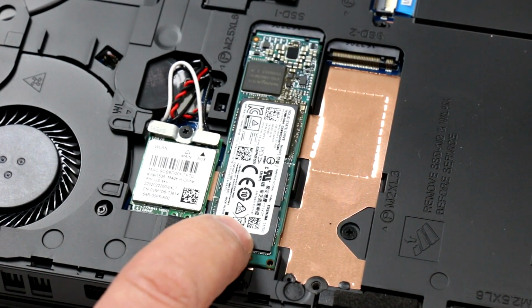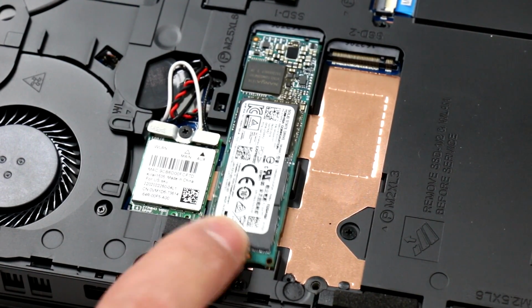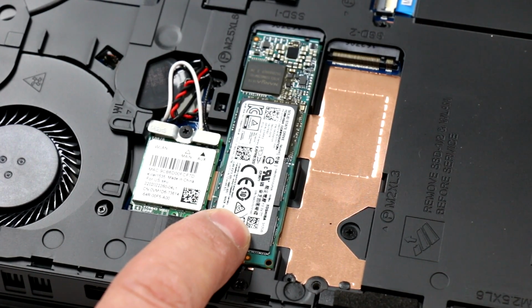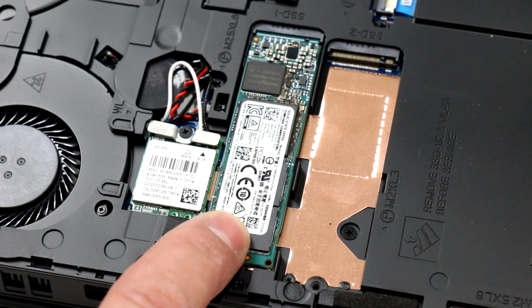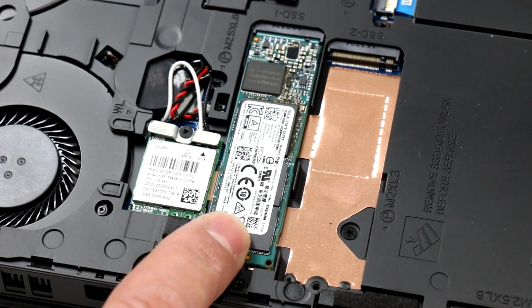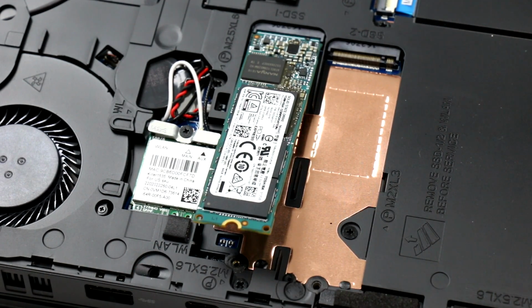I'd advise sticking with PCI Express NVMe SSDs for the boot volume for sure, because they're just so much faster. Specifically this stick, we actually already measured it in Atto, is pushing about a gig per second for writes and about 1.8 gigs a second of read performance. So very good performance from that Toshiba PCI Express NVMe SSD.